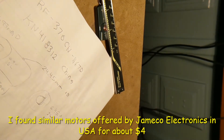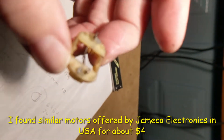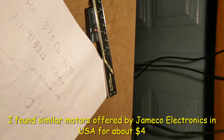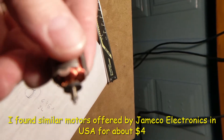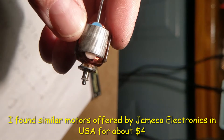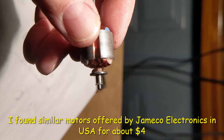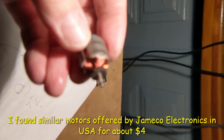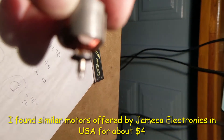I've taken another original one apart and I can see that the brushes in this one were burned up. Looking at the winding of the motor, you can see the commutator is kind of destroyed right there. This motor just quit spinning — it would spin in one direction and not the other, and I believe the brushes are just worn out and no longer working.